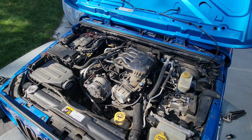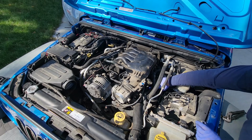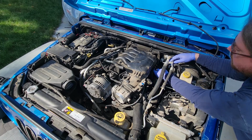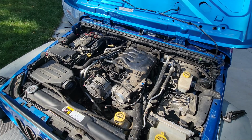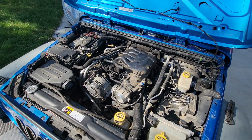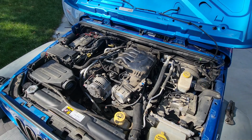One moment. What does the Haynes manual say? The Haynes manual wasn't much help because it didn't say anything about these two nuts down here at the bottom, unless I misread it. It did say remove this Christmas tree off of this bracket back here though. So I'm going to go back to my original idea, and that is to remove these two nuts right here and gingerly tweak this bracket towards me when the time comes.